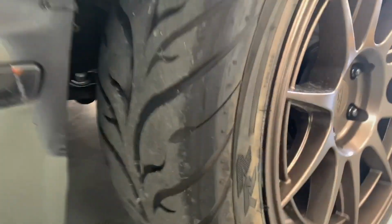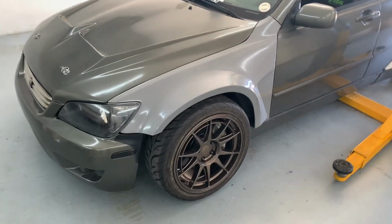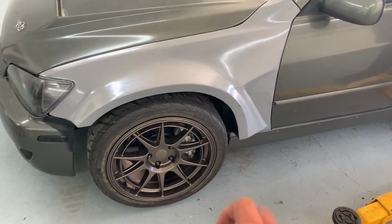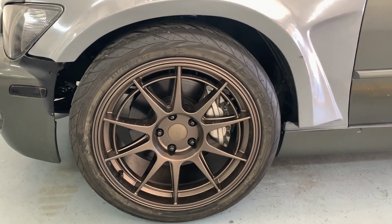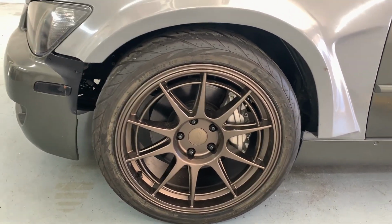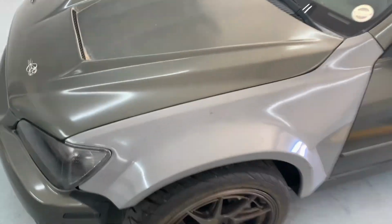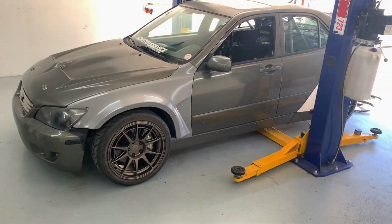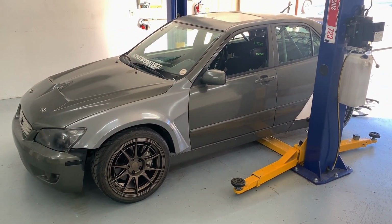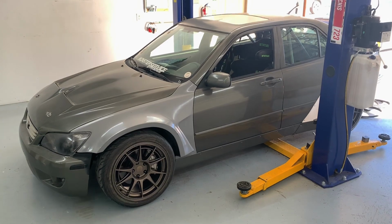Yeah. So what we always run into with Wisefab, of course, is that it's wide. It makes the car wide, and the reason for that is that we want to have at least 65 degrees of lock. So we take a standard size front wheel, in this case an 18-inch 235/40, so this is like 62 centimeters tall or something like that. If you put that wheel on 60 degrees, it's gonna come close to the chassis rail, and we just space out as far as we need to make that big wheel, because this is not a super small wheel for that car. These cars came with 17s and stuff. To make that still do that angle, that's why it needs to be wide. We don't make angle kits wide for fun, there's a reason for it.